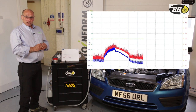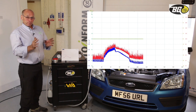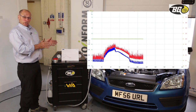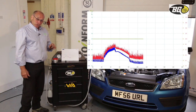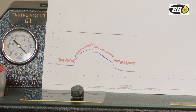When you start the engine at idle, the pressure should still be effectively zero or very close to it — two very important observations. We then open the throttle fully, done with a static vehicle in the workshop, and monitor the range of pressure change reported as voltage. You can see that the change is actually quite dramatic.